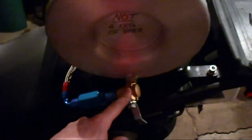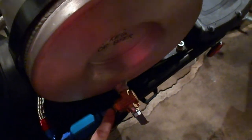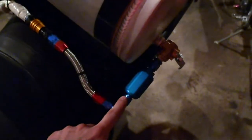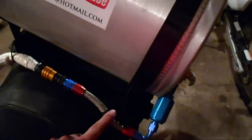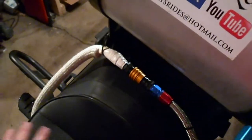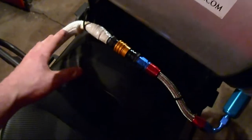The actual plumbing: I have got a 90-degree valve from McMaster-Carr — they are an industrial supplier. I shortened the handle a little bit to clear the saddle bags. Then it goes to an NPT to AN adapter. Everything on here is 6AN. This is a JEGS filter with stainless steel mesh filter material so I can take this apart and clean it. And then I go AN to hose, 90-degree adapter, a little bit of braided stainless steel 6AN fuel line. That is also what is under here, except this has poly glass over it to protect everything underneath the seat and to protect the hose from getting rubbed through. Stainless steel should do that, but I just wanted this on there for an extra layer of protection — more to protect the bike than the actual hose.